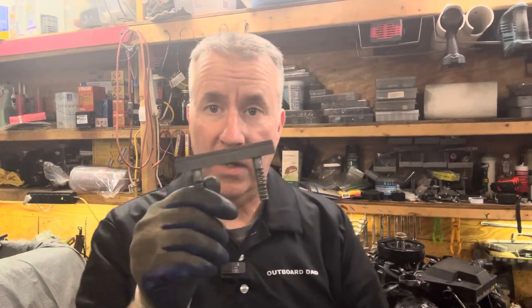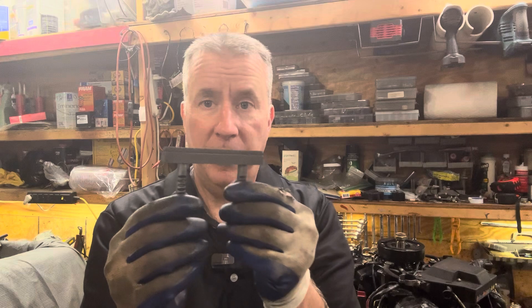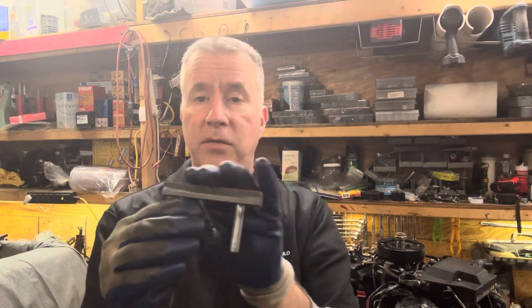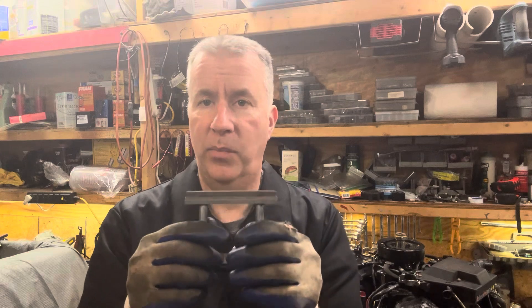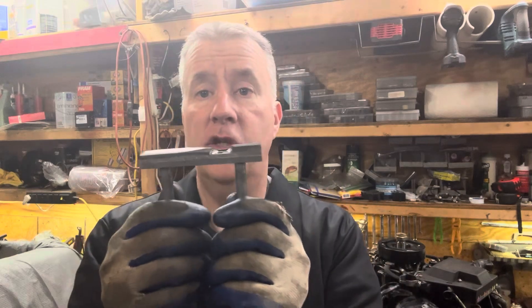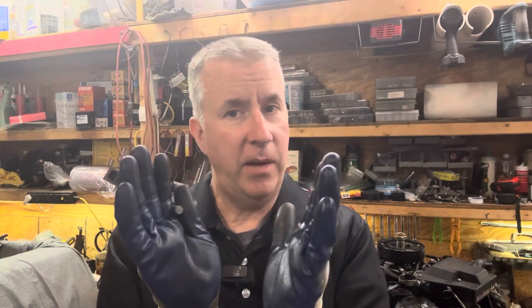What I do is hone first with the 100-grit stones in and out, and then I'll flip them over in the tool and run it in reverse, so I'm wearing my stones a little more evenly until I get all those scratches and nastiness out of it. Then I'll get it close to where it needs to be — within maybe four or five thousandths. Then I'll put this modified stone in and just work the bottom of the cylinder because I'm already starting to taper a little bit.